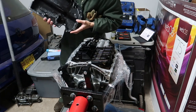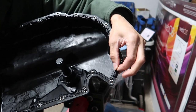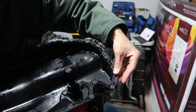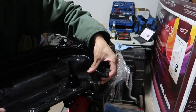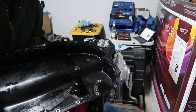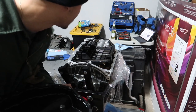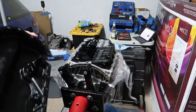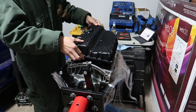There's like a little tab here — a spot where it starts with a little flat spot — so it goes in and holds itself in there. I went through and pushed it all down and around, making sure it's all good. Should just set it on there. All of these torque to 8 Nm plus 45 degrees. I'm going to get them all in with the electric — real quiet — then grab the torque wrench, put down the torque spec, and call it a day.